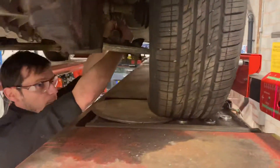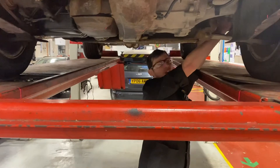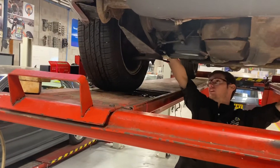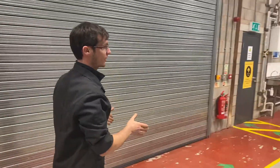I'll open one side, then open that back up, check the gauges, and then lock the locking nuts back up making sure they're nice and tight. Then I can road test the vehicle and make sure that the steering wheel is in the straight-ahead position and the vehicle is running through straight.